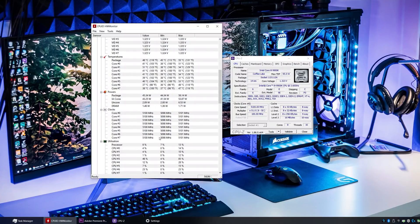That's it — I'm going to save this profile, then hit F10 to save my changes and boot into Windows. And here it is: an 8-core, 16-thread CPU running at an all-core frequency of 5.1 gigahertz. Once you reach this stage you're going to want to run some stress tests, do some everyday computing, play some games, render some video — whatever you do with your computer — just to see if it's stable, and make any necessary adjustments. Remember, every CPU and motherboard can perform a little differently, so if you don't have stability at 5.1 gigahertz that doesn't necessarily mean you got a bad CPU — it just means your CPU might have different overclocking limits and voltage requirements.